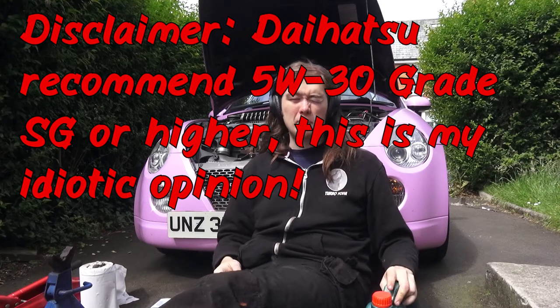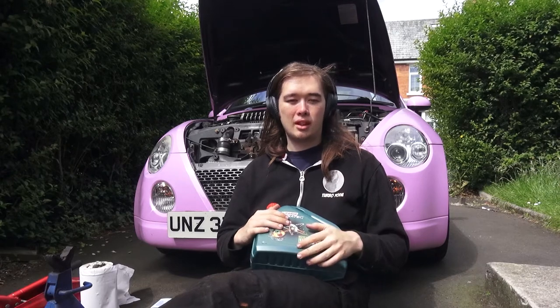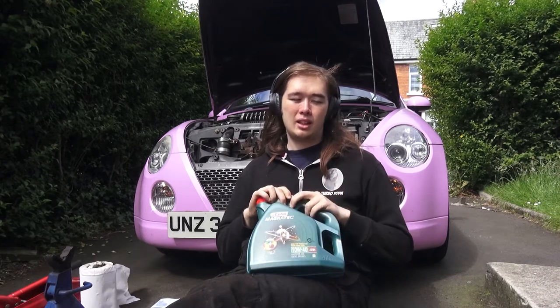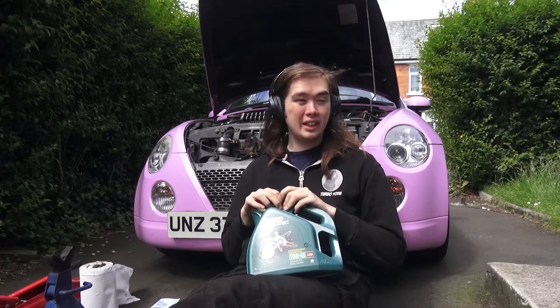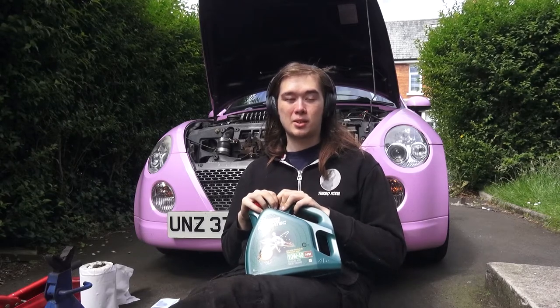The main thing is this car has 80,000 miles on it. I think I've put like 30,000 into it between me and my girlfriend. So I like to put 10W-40 in the car — it may be worse than the factory recommended 5W-30, but I just think with all that mileage, these cars in Japan tend to be retired at 60,000 to 100,000 Ks, and this has about 140,000 Ks. It's a lot for such a small engine, so I like to put in a slightly thicker oil to help it along.